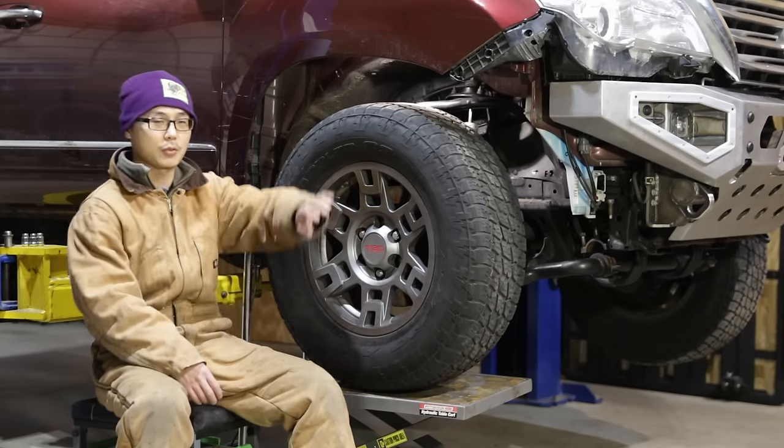The exact added length varies by manufacturer, but usually no more than 1 inch of actual droop at the wheel. Here we have the shock of an extended travel coilover — I have yet to install the lower bolt, so the suspension is at binding full droop. To install the lower bolt, I will need to back off the droop by about half an inch, just like what we found previously. Now you probably wonder — is 1 inch a lot? It depends on the context. For Jeeps with solid axles, probably not. But for Toyota IFS, that is a 13% increase in total travel, a 26% increase in down travel with no lift, and 77% with a 2.5-inch lift. So in my personal opinion, I will always choose an extended travel coilover. For manufacturers that offer both the standard and extended version, they are usually the same price because it doesn't really cost more to manufacture one over the other. Unfortunately, not enough manufacturers offer an extended travel version — most of them are the exact same length as stock coilovers.